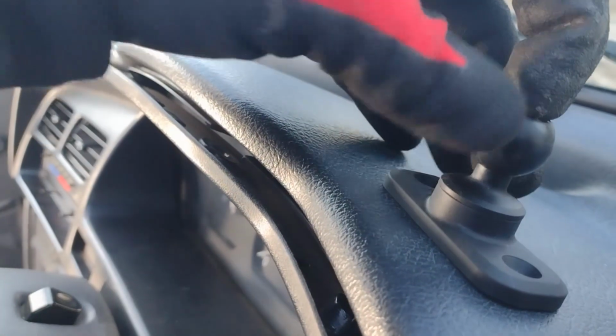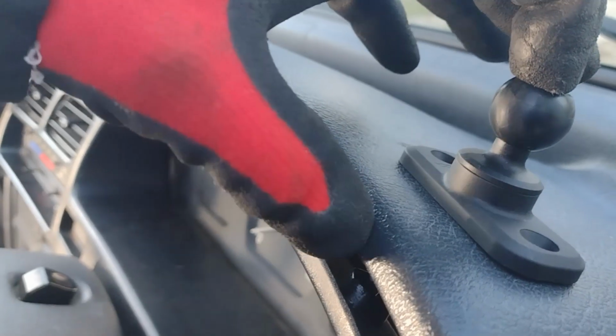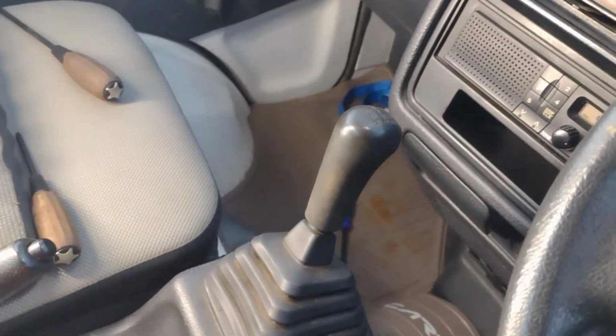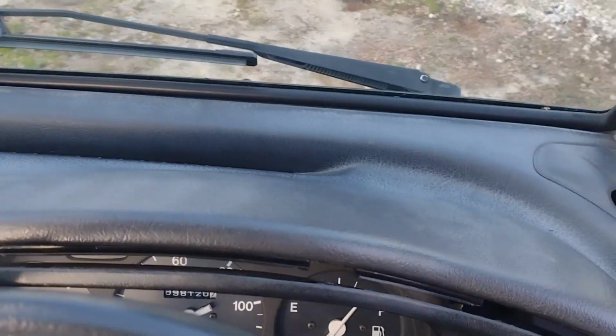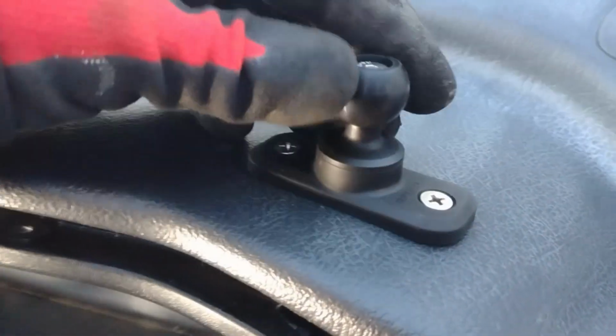It's basically, anybody wants to copy this, at least for this setup, it's 1 1/4 inches from this front edge of this mount to this front edge of the dash here. So I don't like drilling into dashboards. That's the last thing I want to do, especially one as good a condition this is. But I'm going to do it. This is a dry fitment. See how it all looks. It's too late now. We're committed.